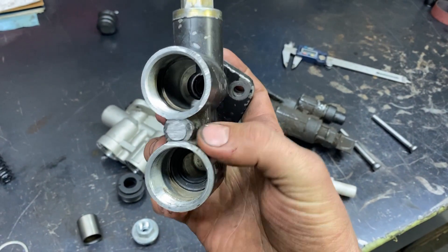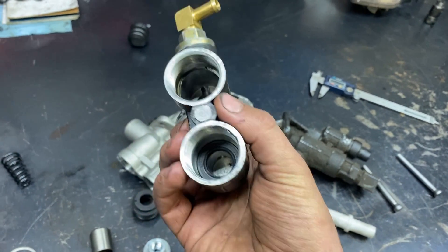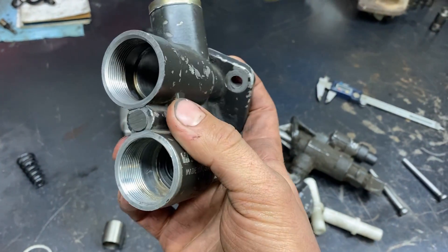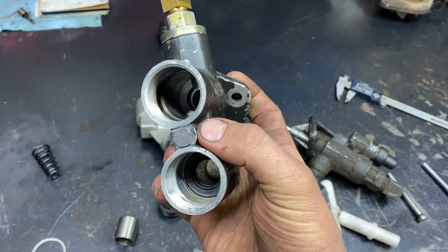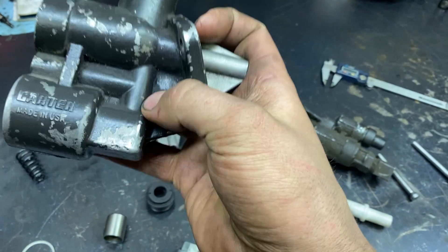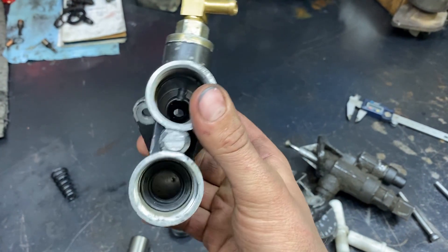There's one more thing you might have to do to certain models of pumps. In the middle there's a relief valve. When the pump puts out too much fuel pressure, the relief valve takes the excess and puts it back into the supply section. Some pumps just don't have it cast in, while others have it as a long open hole. On the Carter original, you'll see a little cap — drill that out and a spring and ball will come out. Then take a 3/8 bolt and hammer it in there, covering the relief holes without intruding on the primer section. Cut the head of the bolt off so it's flush, and the relief section is deleted.